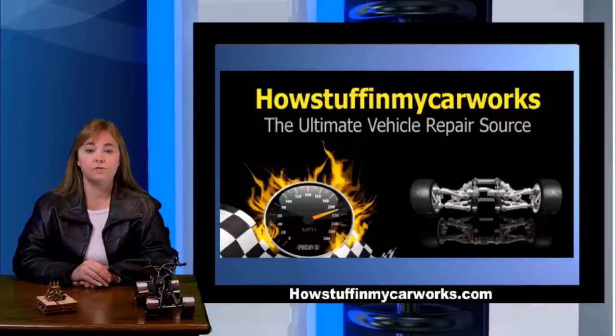Fill the transmission with new Mercon transmission fluid through the plug located on its side. Lower the truck to the ground, connect the battery cable back on, and take the truck for a test drive.